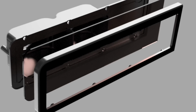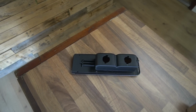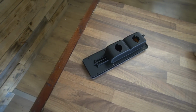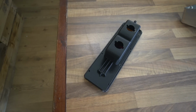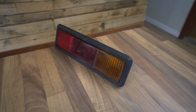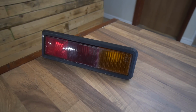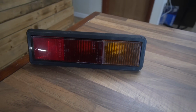So we've gone down the other route of actually modelling and machining, well certainly they will be machined, but modelling so far, our rear lamp housings to take these modern bulb holders. So that's been 3D printed and trialled, looking really good. We've designed the bezels as well, so it'll be off-the-shelf lenses, our own billet bezel and back housing with a newly available bulb holder that has a modern type connector going into it. So nice solution, looking good in that respect.